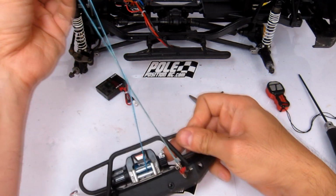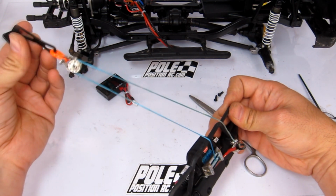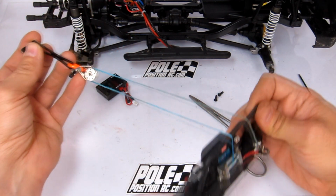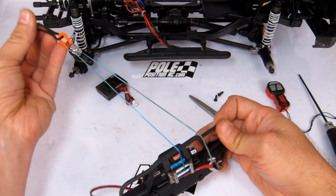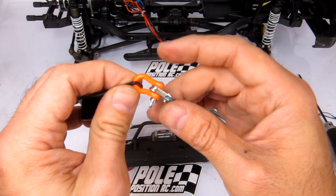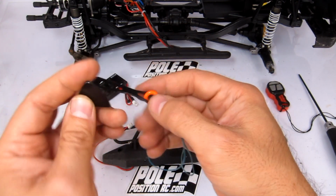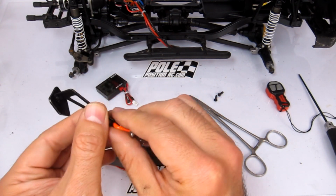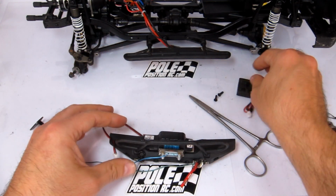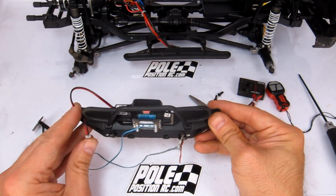And then this is going to attach to the top of the roof bar, the roof cage, roof rack. So you can see that snatch block at the top there is permanently attached basically to the top of the winch. And I've got that heavy duty, the normal size D-ring or shackle attached there, and then I've got a one-piece land anchor. So there we are. So that is it pretty much. So just going to skip ahead, install this back onto the truck, and go from there.